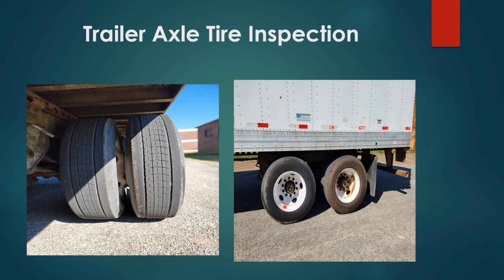Outer rim, properly secured, no damages, no illegal welds. Lug nuts, properly secured, no damages, no rust indicating a loose lug nut. Hub seal, properly secured, no damages, no leaks. Valve stem, properly secured, no damages, no leaks. You have your mud flap and your mud flap bracket. Properly secured, no damages, mud flap more than 6 inches from ground. And your ABS light, properly secured, no damages.